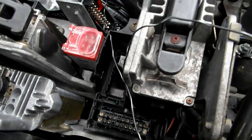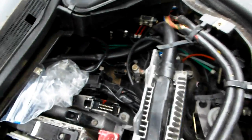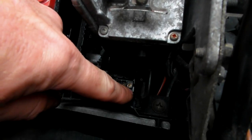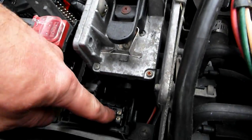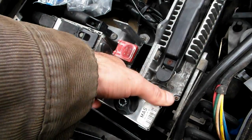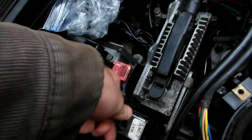To jump the fuel pump, you have to put positive from the main unfused terminal — unfused, so there are no fuses — straight from the battery. Then you have to remove the mass controller; terminal number two is the fuel pump signal. You jump positive to that terminal and that activates the fuel pump to run constantly.